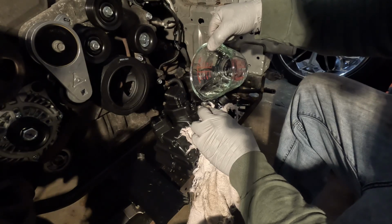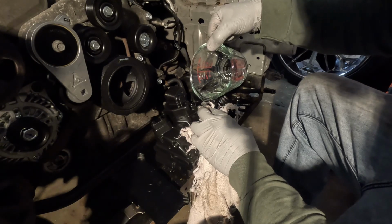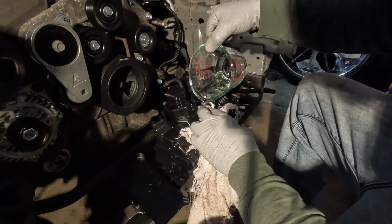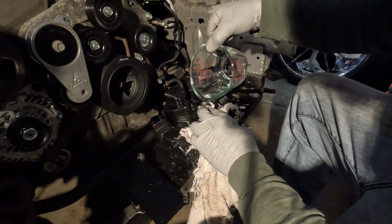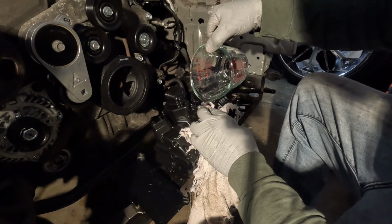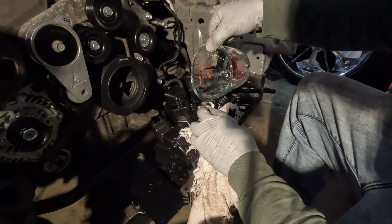Oh yeah, like I said, this thing worked good. It's ice cold, and I already know what's wrong with mine. On the back AC in my truck, they get colder than the front. We're almost there. It might be a little shy, say 5, 10 ounces. It might be 5 ounces. I don't think that's gonna kill it.